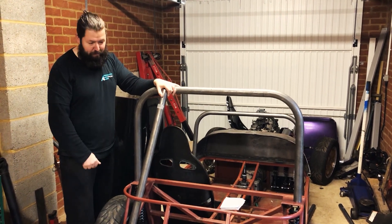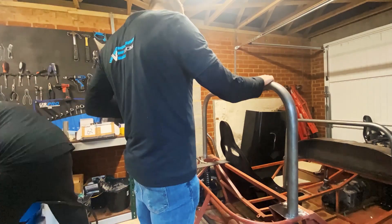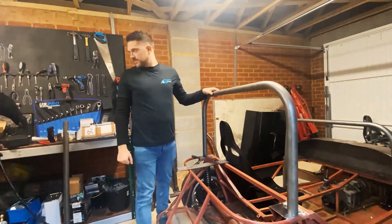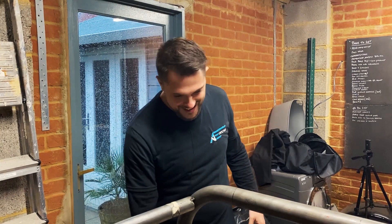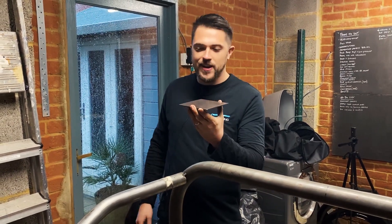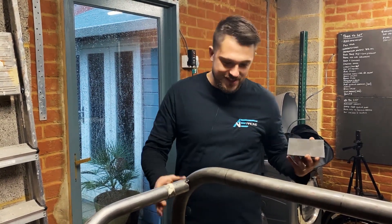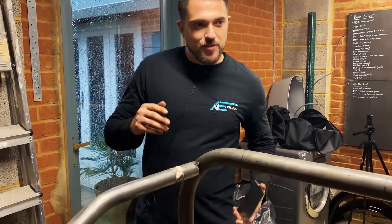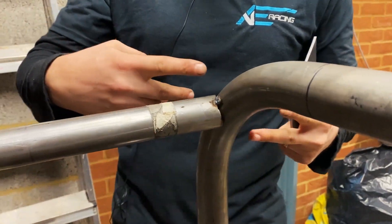Those are the bits we're trying to make sure we're doing today so we don't mess it up. Don't skip leg day — that's a big rule when it comes to working out, and if everything's strong you need a very strong foundation. That's where these come in: little bits of square plate steel. Wherever the roll cage attaches to the chassis, one of these has to go just below it, so that if you are in an accident all that impact energy will disperse through there and keep it nice and rigid. We've also got to notch out the end of the roll cage tubing so that they attach nice and snug together.